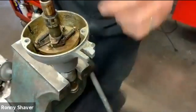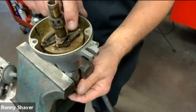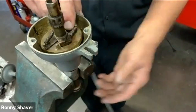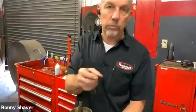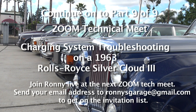You want to make sure that this advanced mechanism isn't frozen — it should spring back to zero every time. When they get old and worn and aren't lubricated, then sometimes they won't come back all the way. So what will happen is you'll set the timing statically and it's not back all the way. You'll drive the car and it comes back idling slower and not running very good because those weights came back.